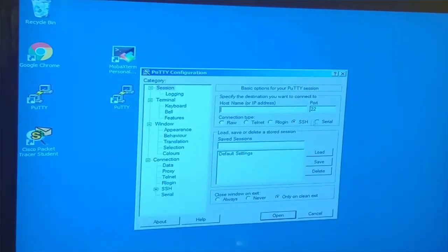Now we have the software and the cable connected to the router. All I need to do is turn on the router. There's the sound - remember we're doing all of this physically because that's how you want to do real practice. The router is going through its boot process now. Let's use PuTTY to connect via serial connection. Open PuTTY and you'll see the 'Serial' option - it automatically defaults to COM1 at 9600 baud speed.